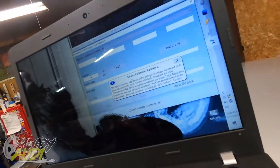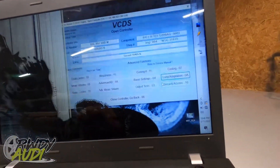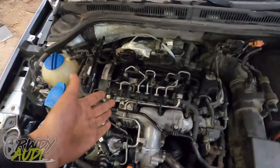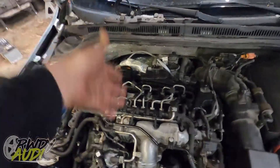And that's all you really got to do. After you're done, hit done, go back, close your controller, and shut your car off. Something to make sure to note: if you don't do this and you were to swap your engine or swap your injectors, your car is going to go into limp mode and do some really funky things. It might not go over 40 miles an hour, or it might not even do 20 miles an hour.